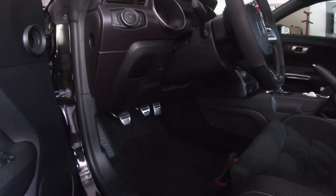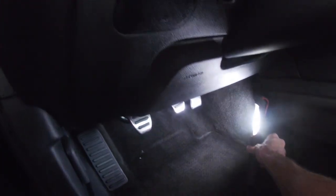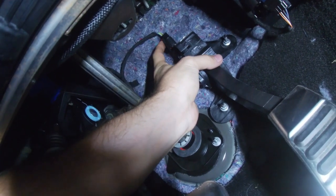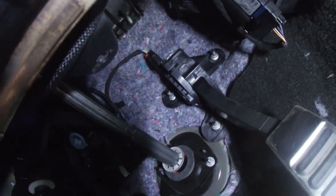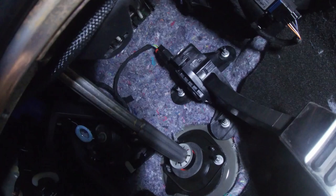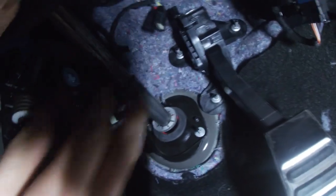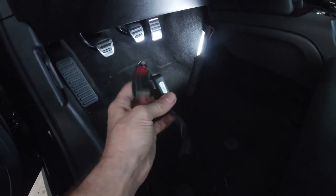It's been about 10 minutes, so let's get to the install. We're in the driver's side footwell — you're going to want to have a good light source. Over here we've got the accelerator pedal electrical connector. What we're going to do is simply unlatch the red locking tab you can see on the top of it — that's going to allow you to depress the actual locking tab and remove the connector. Just push the tab and pull the connector up.